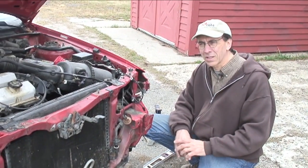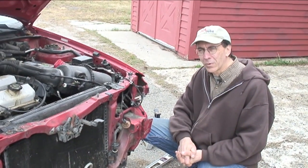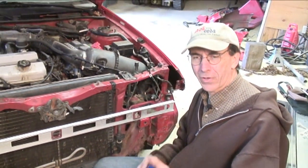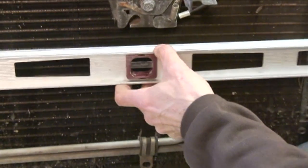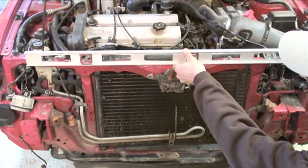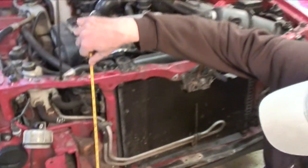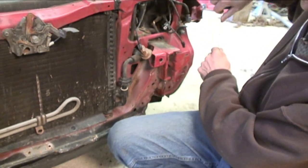I can't emphasize safety enough. Safety is number one — we don't want to get hurt in the process of having fun. Let's bring this inside and see what we got. We got it inside now, and now we get to do the tests. We don't have a frame setup, so we'll do the best we can. We're not perfectly level here, the bead is off a little bit, but the vehicle is sitting that way too. We're level with the top of both frame horns, and they are parallel. The height off the floor is 21 here and 21 here, so that's pretty good.